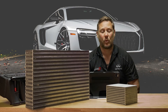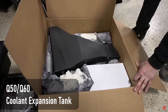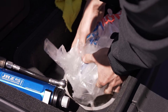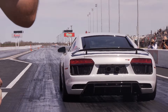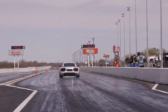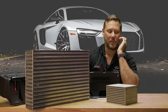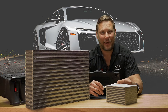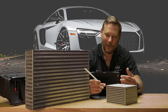So that's some of the things we're taking into consideration redesigning products and accessories. We'll put bigger heat exchangers to get rid of that heat and more capacity to make it more stable. The advantage of putting an ice box or reservoir is you can circulate 40 degree water through the intercooler. So you might get a charge temp out of this intercooler that's actually colder than the ambient air outside. It's a hundred degree day outside at the drag strip, you're pumping 40 degree water — you can have a race car making a ton of boost and getting 60 degree charge air out of this thing, which is fantastic. But if you're in Las Vegas or St. Louis in the middle of July, a hundred or 105 degrees out and super humid, you don't want to be using that ambient air to cool down your charge air.